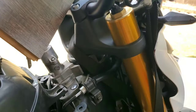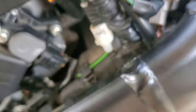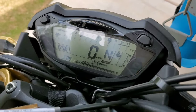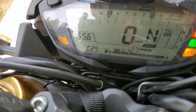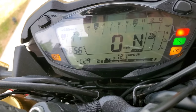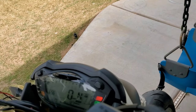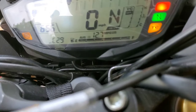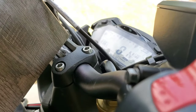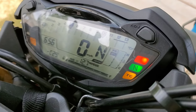I'm turning the bike on again and connecting the secondary TPS. I now have an error — I'll clear it quickly. I'm slowly moving the TPS while keeping an eye on the dashboard; the error is going away. You can see it's now in the middle — I barely touched it. I'm applying downward pressure on the TPS rather than upward, and that's how the reading is coming up. A little more pressure and it's still showing in the middle.